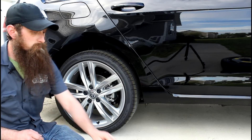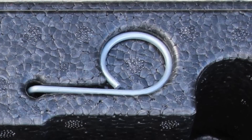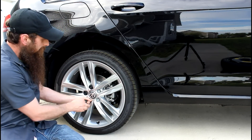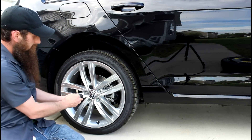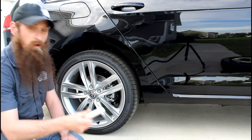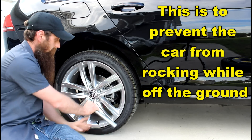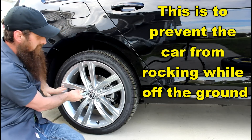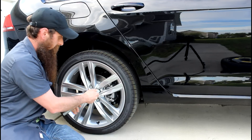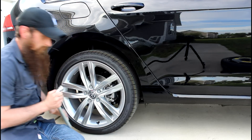Before we lift the car up using the jack, I always like to loosen all of the wheel bolts. There's a small tool in your tool kit — this is used to pull the wheel caps off. So we're going to pull these all off and set them in a place where you're not going to lose them. Next, we get our breaker tool and we break our wheel bolts loose — nothing more than just a little bit. We still want the wheel to stay on the car. All right, those are all loose.